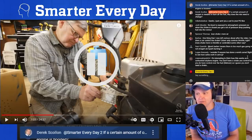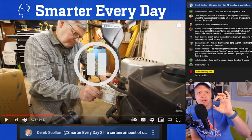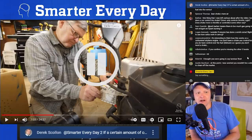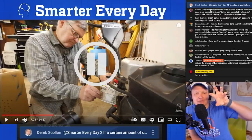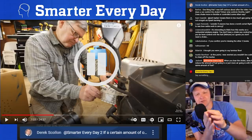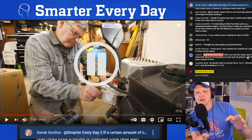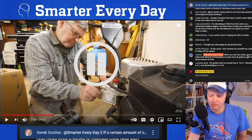And the answer has to do with thermodynamics, usually. Like, for example, on an injector plate at the head of a combustion chamber for rockets, sometimes you'll want to run something along the outside edge of the rocket, whether it be fuel or oxidizer, depending on which one's more dense and which one you can carry more of. So what you might want to do is run that on the outside of the nozzle. So your injector plate would be like one-to-one mixing, or whatever your stoichiometric mixture is, so that it would go boom in the right way. But you could have some cryo fluid on the outside edge, and that would cool or give you a boundary layer on the inside of your nozzle to keep it from melting. Fascinating stuff. Literally rocket science. Smart people do all that math.